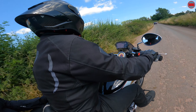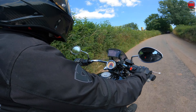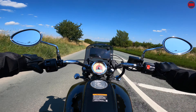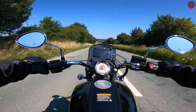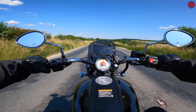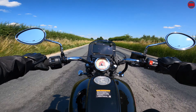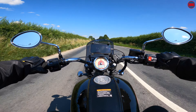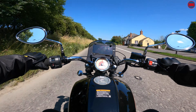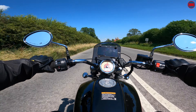On faster bikes like my Aprilia, the back brake is really just about balancing the bike, not doing a huge amount of stopping work, but on this bike it was almost completely the opposite. When I did deploy the front brake, steaming into slightly hotter corners, I found it to be nice and progressive, allowing for a really smooth and controlled scrubbing off of speed. These ain't M50s, but honestly for the type of riding most people do with this bike they are pretty fine. My one big complaint about the brakes is actually the lack of an adjustable brake lever — it's too far out for my hands, especially with the Grip Puppies installed. An adjustable set of levers will make a really big difference.